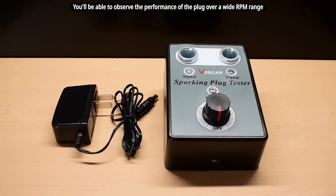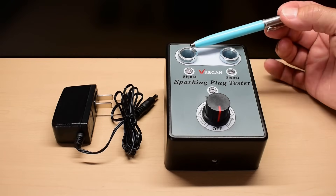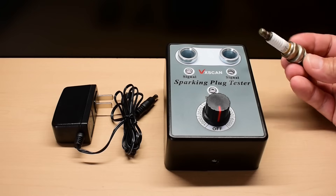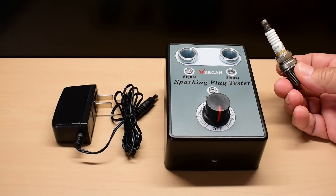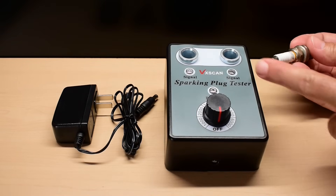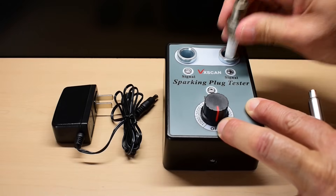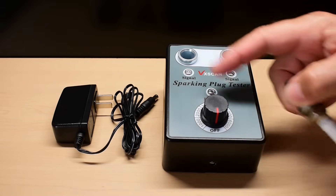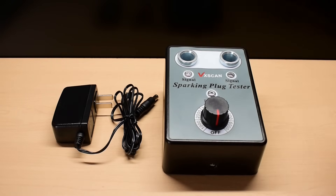You'll be able to tell very easily if the plug is good or bad. I've seen these testers being sold with different size holes. The one you see here has a larger hole opening, and there are other ones that are much smaller. If you purchase the smaller one, you're only going to be able to use a smaller insulator plug. This plug from my Hyundai Sonata fits fine with a lot of play, but it still makes good contact between the tip and the metal ring on top. If you had a plug with a larger insulator and tried to insert it into the smaller hole of other brands, you will not be able to test them. So make sure you get the larger one to be able to test both.